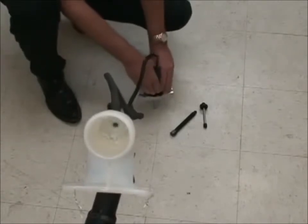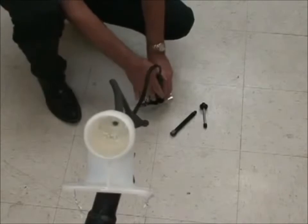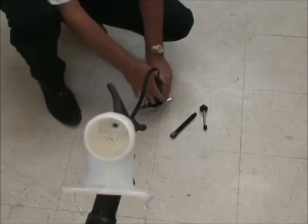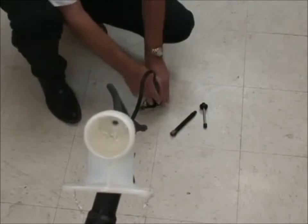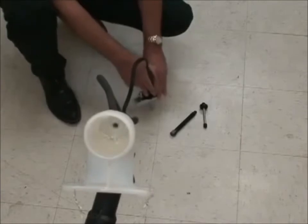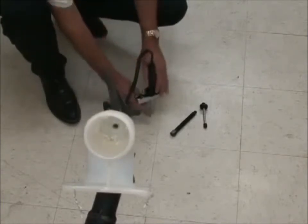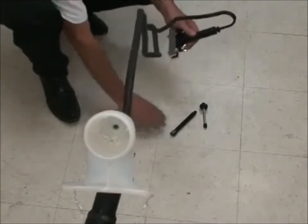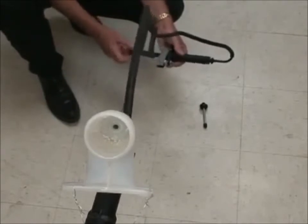Could you do this in chassis? Maybe, but it would be a lot easier to take it to the bench. A lot of these are just quarter-turn pop-outs, like this one I'm working on — quarter turn and that master cylinder will come out of that bracket. You get the whole system to the bench; it's easier to work with and might only take one person to do this. Then just snap it back in the firewall in the bracket and attach the slave cylinder.